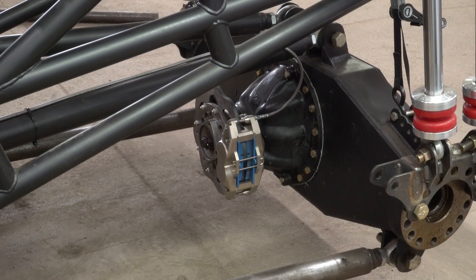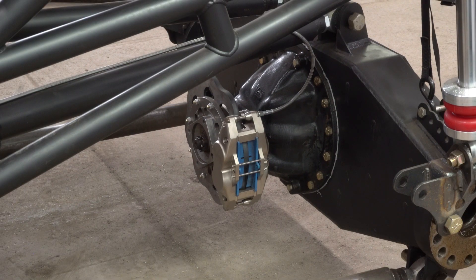I got both center sections mounted front and rear. I run a 620 with a spool in the front and a 614 with a locker in the rear. All the brakes are hooked up and bled. If you take a close look at that caliper, technically the brake line should be at the bottom and the bleeder at the top, because the bleeder has to be at the highest point for air to come out. But the easiest thing for me is to just open the bleeder and let it gravity bleed — get a good amount of fluid in and bleed it at the line. You could also pull the caliper off, flip it upside down so the bleeder is highest. I don't like running the line low because it can get snagged on things.